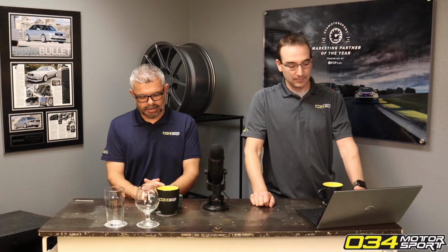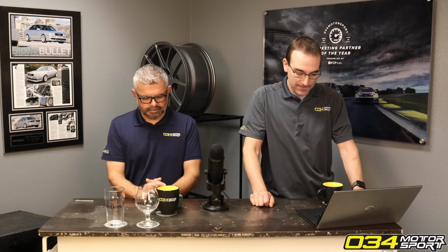You could also put a pressure port pre-cat and measure the pressure, with silicon caps on the ports. You've probably seen those on cars from the 80s, like Audi 4000s and everything had them. Yep, Audi 5000s. But yeah, at some point a test pipe will flow more, but a properly designed high flow cat can be made to flow any CFM you want.